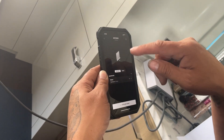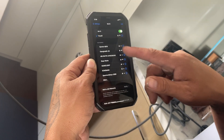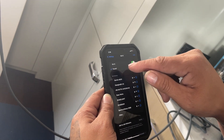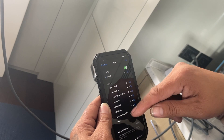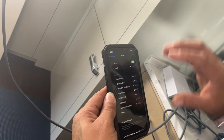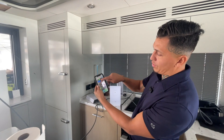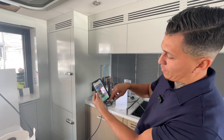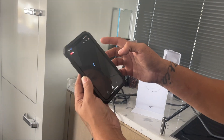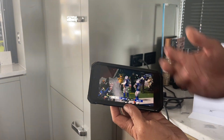Go to your Starlink app and connect to a network. It'll take you to the Wi-Fi area where you'll see 'Starlink' listed. Click on that and you'll be taken to a page to set up your username and password. To test connectivity, turn off your phone's cell service and use the app to confirm you're connected through Starlink only.